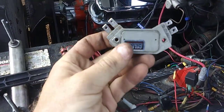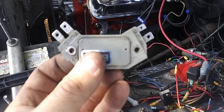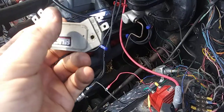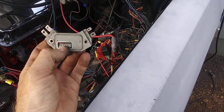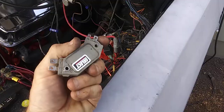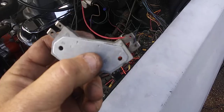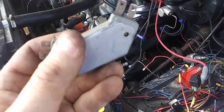The original module was bad — it just wouldn't let the vehicle run no matter what. One way to tell a module is bad: sometimes it runs fine until it warms up. You can take these to the parts store and run three to four tests on them. Let them heat up between tests. If it passes while cold but then fails after heating, the circuit inside is shorting out from heat, and once it cools down it'll start the vehicle again. So run three to five tests to confirm it's genuinely good.